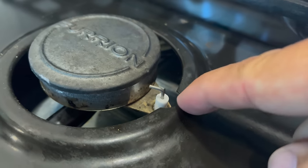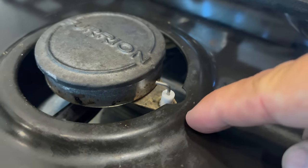However, I had one more catch. I put the stove back together and I was clicking the lighter, and the way I had adjusted the igniter turned out not to be the right way. You've got an insulator and then the wire coming out, and bending that back allowed the insulator to drop below the frame, the bottom of the stove, and it was arcing to that instead of the burner. When I tested this, it didn't do that because I didn't have the stove put together.